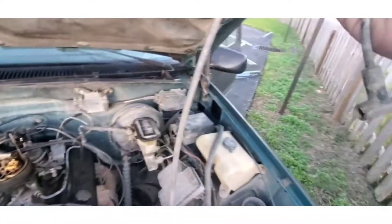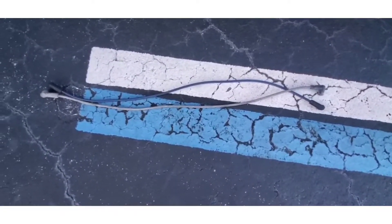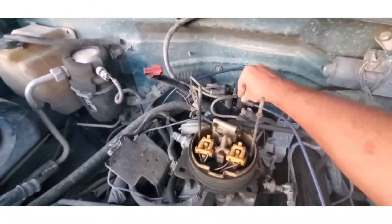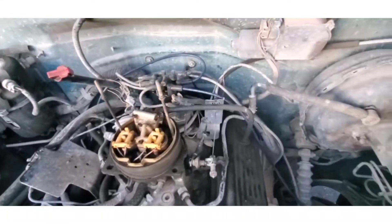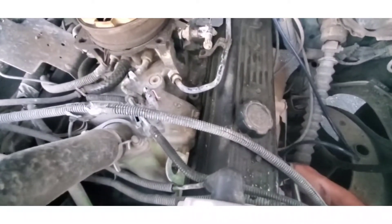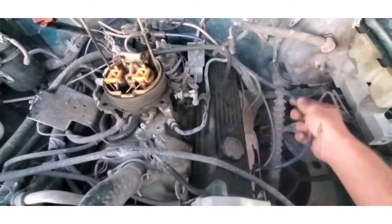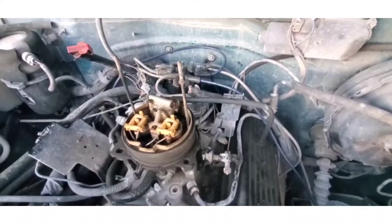And that's how I find out that it runs right to the front of the engine right here. Just like that, one wire has been removed. You're going to want to make sure you're replacing it with a wire of the same length. When it comes to plugging it back up, you put the new wire over the spark plug, push it down, get it on there nice and good, and feed it down to the same spark plug you pulled the other one off of. Push this end back on the distributor — that's all there is to replacing a spark plug wire.